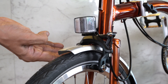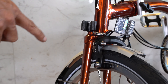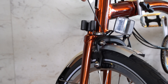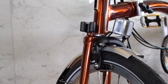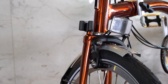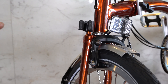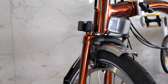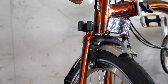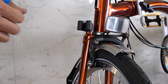I'll demonstrate now. Not sure if you can see it on camera, but basically the wheel moves to one side and twists once the brakes are applied. Now, we shall be changing our tool to a 2mm Allen key. If we turn the Allen key anti-clockwise, the brake will move towards the left side. If you move it in the clockwise direction, then the brake will move out towards the right side. The left and right side being from the rider's point of view. The goal of this adjustment is to make sure that both sides are balanced, having the same distance from the brake pad to the rim.